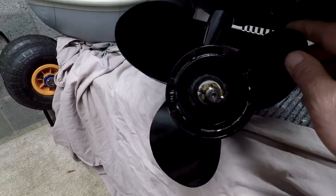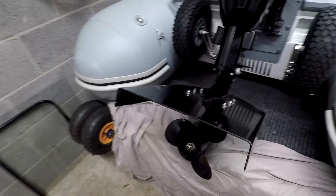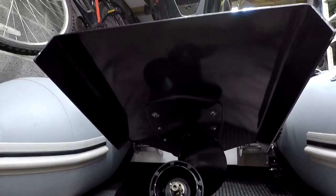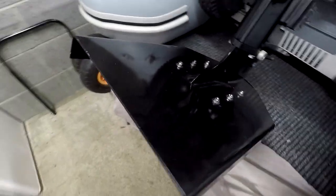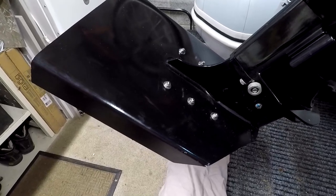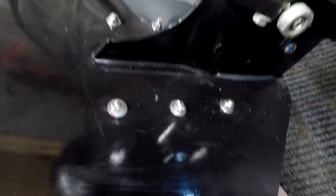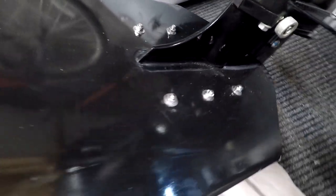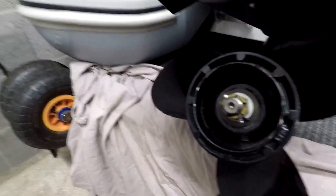I'll put a link in the description of the company I sent it off to. Last year I fitted a two-piece plastic hydrofoil, but this year I've made a trim plate, or perma-trim as they're called. There's a sheet of aluminium I got off eBay for about £16.90, free delivery — I'll link that in the description too. Fitted with stainless steel nuts, bolts and washers. With the raised transom height and the cupped prop, this will hopefully make a big difference.